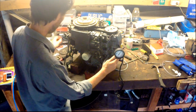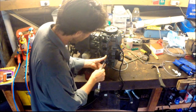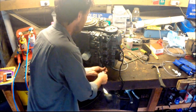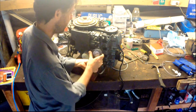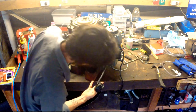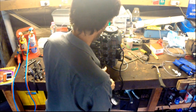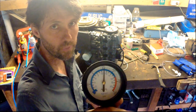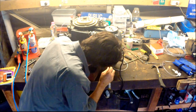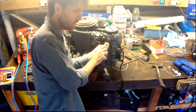I'll reset it. It's giving me 150. I do recall cylinder 3 being the healthiest one on the leak down test as well. It's a pretty good reading for that one. I'll just reset it and try one again, cranking it a little bit longer. You need about 10 full revolutions really to get a good reading.